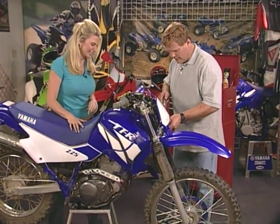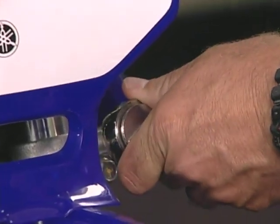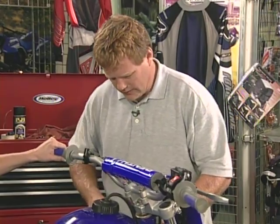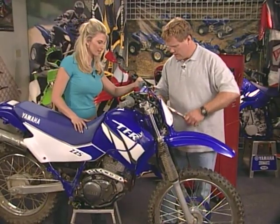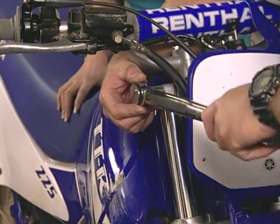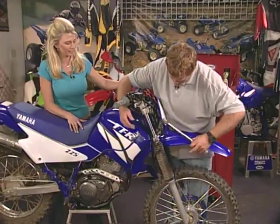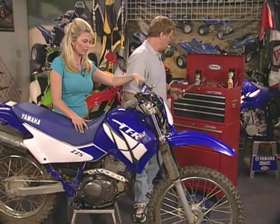Set it at about 12 foot-pounds and just kind of go by until you hear it click right there. That's as tight as you need. You hear that little click right there? That's tight. Come up to the front. Click there. Click there. We'll do the other thing over here on this side. You hear that? That's telling you that you got enough torque on the bolt. It's perfect. How's it feel? Good? Feels good.